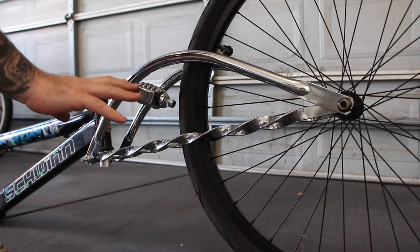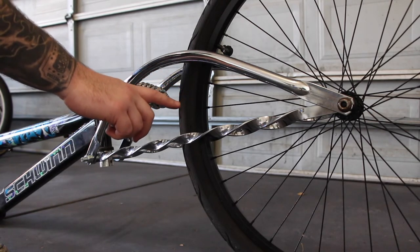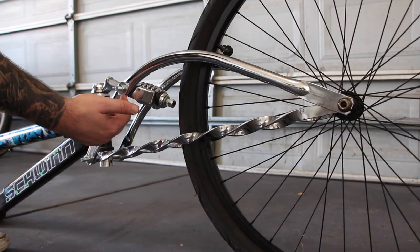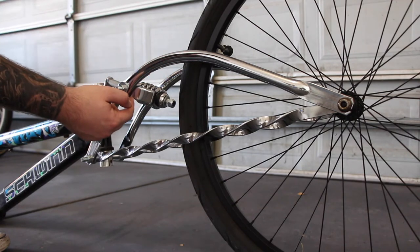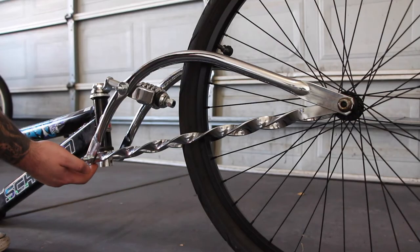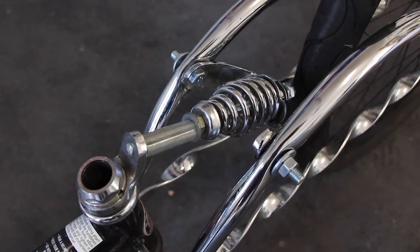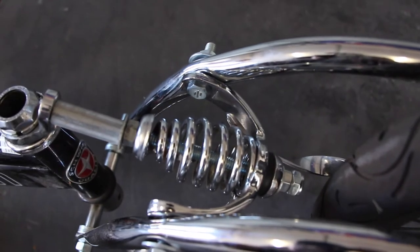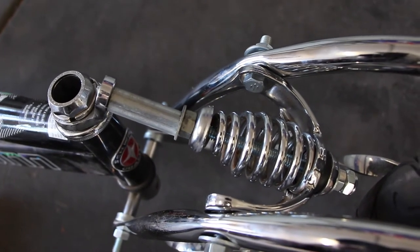The front fork setup is just a 26-inch springer fork big bend setup flipped upside down. The crown is positioned in between these two big bend supports — usually where the T-bar goes — and then the top end that usually attaches to the crown goes through the T-bar to get that extra length and lowness. I've got a bit of all-thread running through as a makeshift bolt for now, and a little tube there to space out the spring. I'll make that prettier once the welding is done.